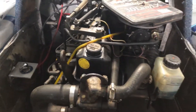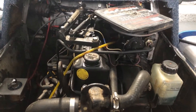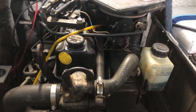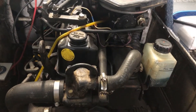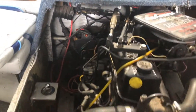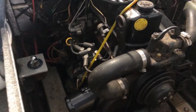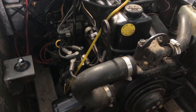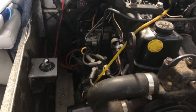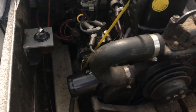This one is raw water cooled, so you're gonna have differences if you have a fresh water cooled engine. Your pressure test is going to be a little different — you're going to pressure test it as a separate system and then check the manifold. But the leak down test I think is the big one. I'm gonna pull the plugs out right now to see if we've got any discoloration from water entry, which'll help us pinpoint possibly an exhaust manifold, because these are exhaust and intake manifold in one — so it could be dripping down into the bottom end when it's at rest.